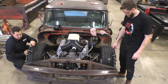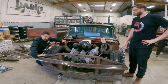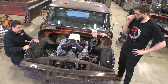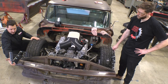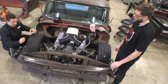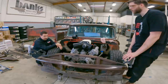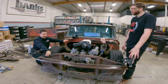With our hood hinges mounted now, there's a decent amount of weight hanging off this core support. We can't fit the factory inner fenders, which gap the core support from the firewall and hold it in position. So we're actually contacting our tire right now, which isn't good — not what we want. These hood hinges are going to hang a lot of weight out here, so it's going to want to pull the other way. The fenders and inner tubs are only 19 or 16 gauge — they're not made to be a structural member. They'll hold position, but we'll still get deflection depending on how the hood sits. So the best thing to do is to add something in here to stiffen this whole setup.